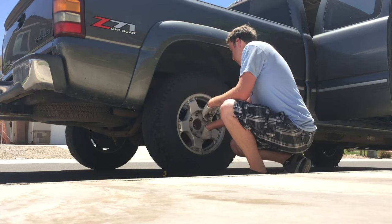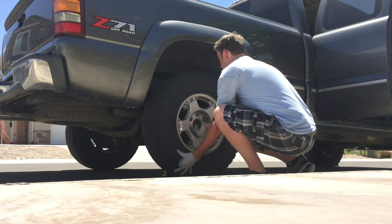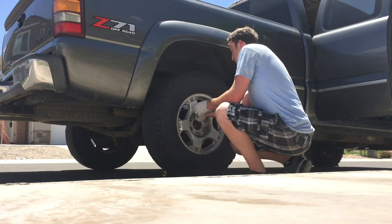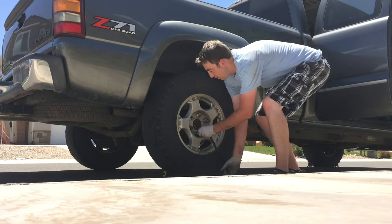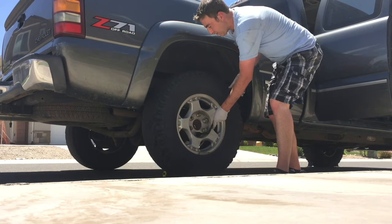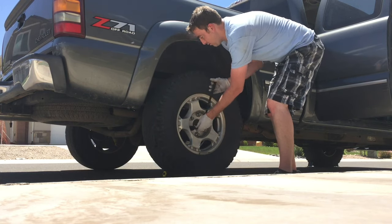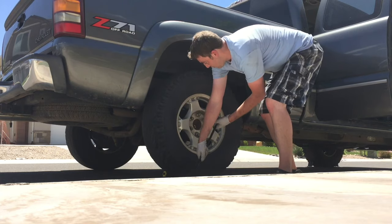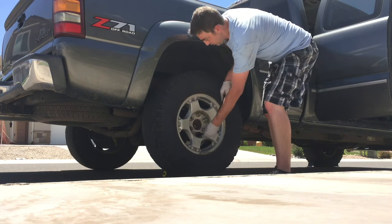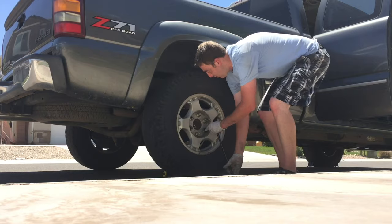What you'll want to do is put the lug nuts on opposite of each other. I like to put one on the bottom and one on the top — that just kind of holds the wheel on. You want it flat against the wheel hub, then put them all on by hand as tight as you can. Next, tighten the lug nuts down — notice how I'm going opposite of each other. Whichever lug nut I tighten down, I go to the opposite one across from that. That's called the star pattern, and that way it seats the wheel properly. Notice how I'm getting them snug but not completely yanking on it right now, because you don't want it to come off that jack. Once they're all pretty well secure and tight, then you can tighten them down some more. Just make sure you're getting them pretty much as tight as you can with that little bar.